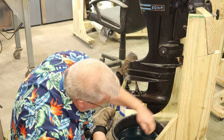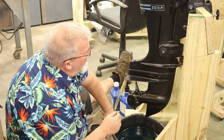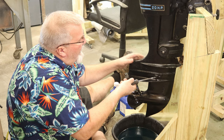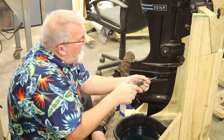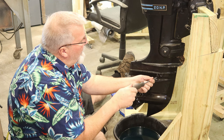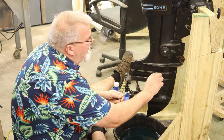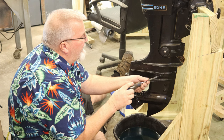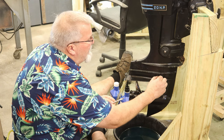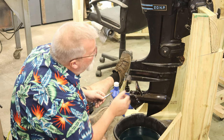Pull the bottom plug back out, you know, from when we drained it the other day. And I'm also gonna remove this upper plug right here. It's the little guy, not the big guy. It's the little guy on this one. One day they finally got smart and they started putting the same size plug on both sides, you know, instead of just the big one and the little one. So I'm pulling her all the way out here. We're going to set it right there.